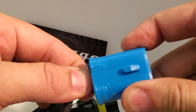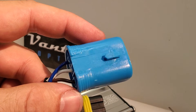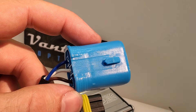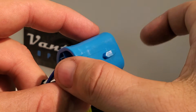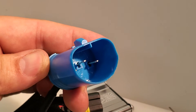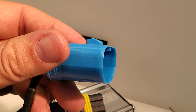If the clip on the car side is broken — which is very, very common — you can do something as simple as run a zip tie through both sides. Just make sure it goes in between one of the wires on the harness side and one on the car side. It doesn't have to be super tight, but it will keep them pushed together even without the mechanical clasp. These connectors on some of these cars are approaching quite an age and are obviously brittle and need to be treated as such.